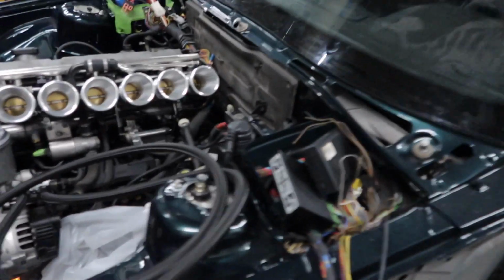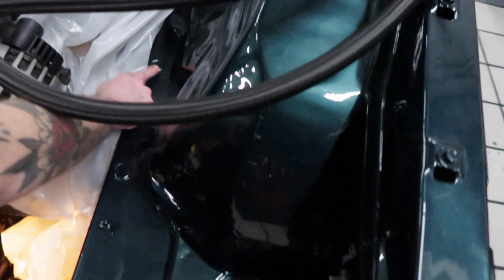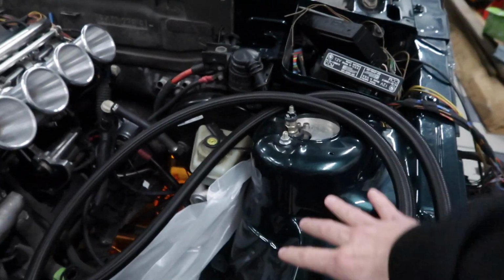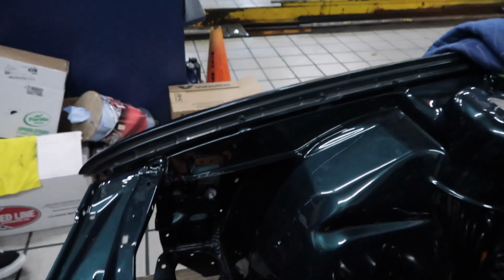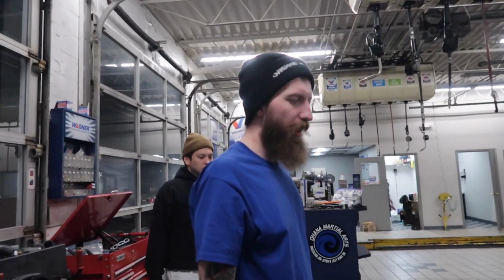I forgot, he shaved. Well, kind of half shaved, right? It's partially shaved. I didn't weld in finish plates here, but all the body lines along the frame rail and the strut tower are smoothed over. If you have an E34, all the boxes and mounts and stuff, so this is all smooth. All the studs got ground off, and a bunch of holes here got filled with weld. So that's a ton of work not related to an S54 swap. No, that's him being a perfectionist wanting a clean engine bay.